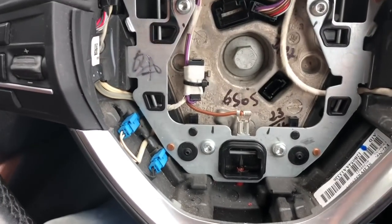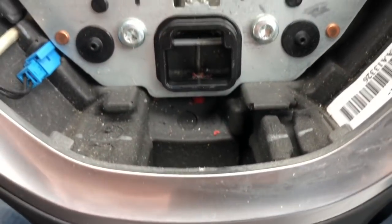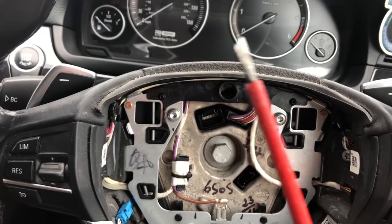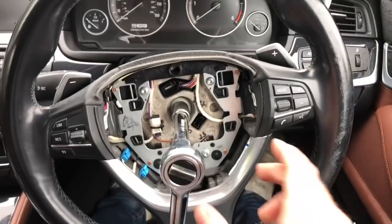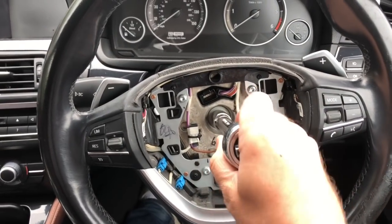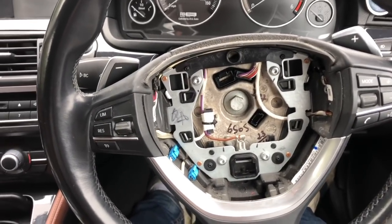This release point at the bottom is where you can see my screwdriver just coming in. You've got to aim to get your screwdriver onto the bottom of that and push it up — that's where the fiddly part happens. The hole is very narrow, which is why I've got a thin electrician's screwdriver. Mine actually released pretty easily. It's a 16mm socket on a short extension — give it a tug and it releases. I undo it by hand and the wheel should just come off.